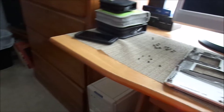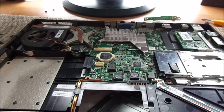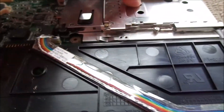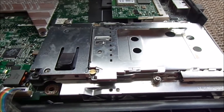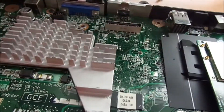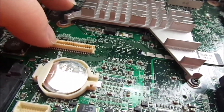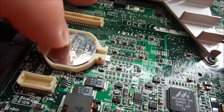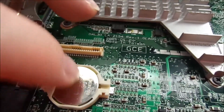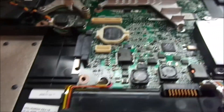Before I do that, I wanted to show you guys what the motherboard actually looks like. For those of you that watch my channel, this is what the motherboard in a Dell Inspiron 1501 looks like. You can see right here this is the PCMCIA card slot. I have the wireless card here. The CPU is right over here. I believe this is the GPU, the graphics processing unit. This is where the keyboard plugs in. Right here you have your standard CR2032 CMOS battery, which I will be changing because I believe this is original to this laptop, and this laptop is from 2006, so that definitely needs to be changed.